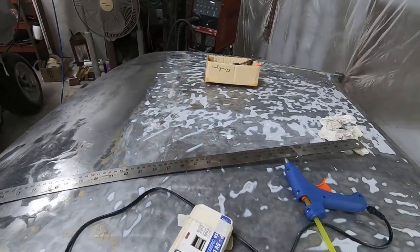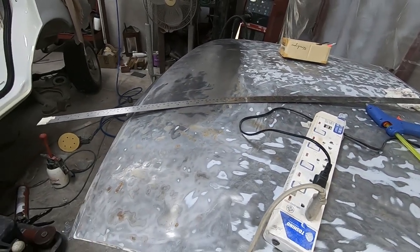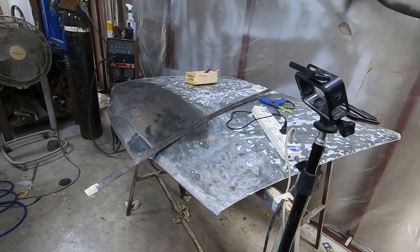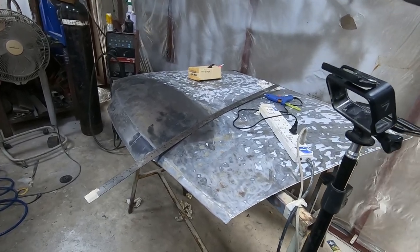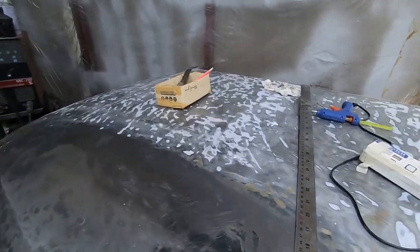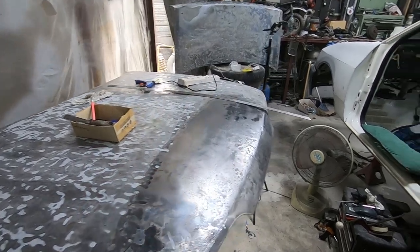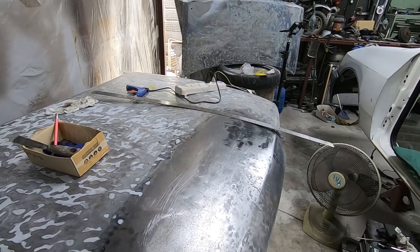I'm happy with that shape. Next thing to do is clean up the inside, get it ready for painting, then flip it back and DA all this off because it's got to be primed as well. It's taking shorter than expected. I'm not going to bother with glass-fibre reinforced filler — there are no structural repairs and it doesn't seem to need much depth of filler. When I did my Escort, the bonnet had been tap-danced on, and I borrowed some long splines off a paint guy — they were brilliant for doing long panels.